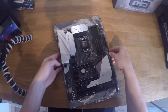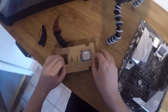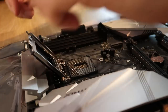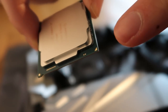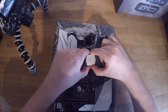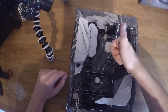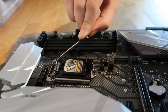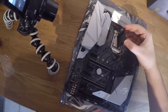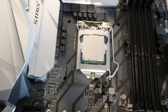I'd love to know your thoughts on this build. Once I had the motherboard all set up, I got my Karambit Crimson Web Knife and decided to get the CPU out ready. I lifted up the lever and then located the arrow on the CPU. That small arrow indicates which way the CPU goes into the motherboard. Once the CPU has gently been placed into the motherboard, you then pull down that lever. It can be quite tough, but you've just got to put a bit of pressure on it. The bit of plastic on top should just fall off by itself. Then once the latch is secured, just put the plastic to one side or throw it if you're like me.